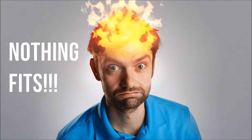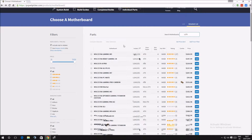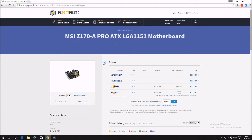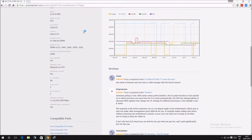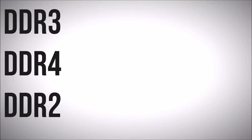The first thing we need to know is whether it will be compatible with your other hardware. The first one to check is the motherboard. Look up the product page on the manufacturer's website and scroll down until you find: what generation of RAM it supports, how much of it it can handle, and how many DIMM slots it has. The generation is the most important aspect and it will most certainly be the last generation DDR3, the current generation DDR4, or the by now pretty ancient DDR2.